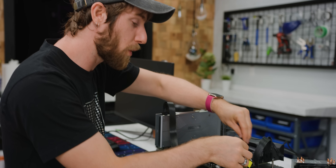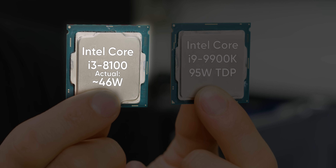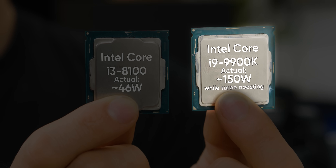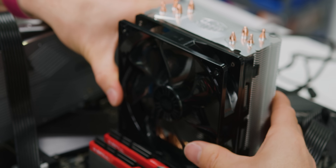That means I'm ready to take things to another level, because acceptable performance doesn't equal optimal performance. Surely if it didn't make any difference whatsoever, Cooler Master wouldn't bother with the 'peel this thing off' warning. So to take things to the next level, we're going with an Intel Core i9-9900K — an eight-core processor rated at 95 Watts TDP. On paper that doesn't sound much more than 65 Watts, but in practice Intel's TDPs are more like pirate code guidelines. That 65-watt chip almost certainly doesn't consume 65 Watts, while this 95-watt chip, especially with multi-core enhancement enabled, is going to consume way more than 95 Watts. And here it is. Absolutely disgusting.